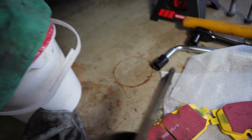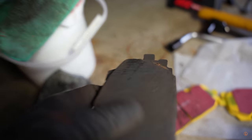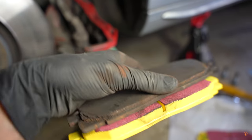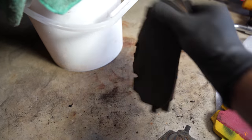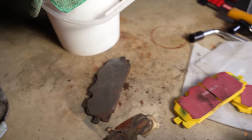Let's look at the pads — dude, these are fried. Holy cow, look at all the crap coming off them. So this is pretty much toast; I'm glad I'm getting new ones for the track day. Look at the difference. I would actually highly recommend you wear a mask — not just because it's COVID season, but because of all of this particulate matter on here.